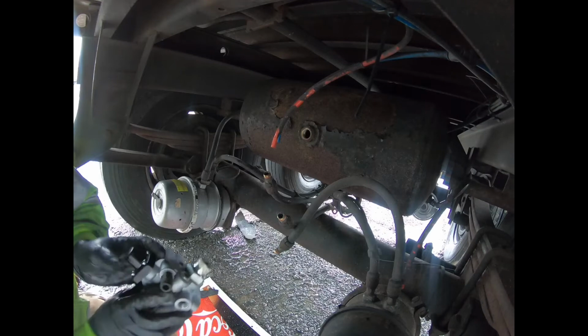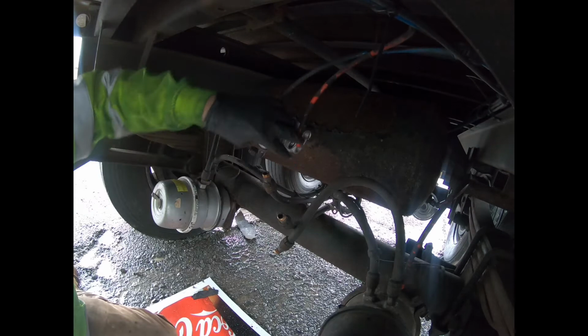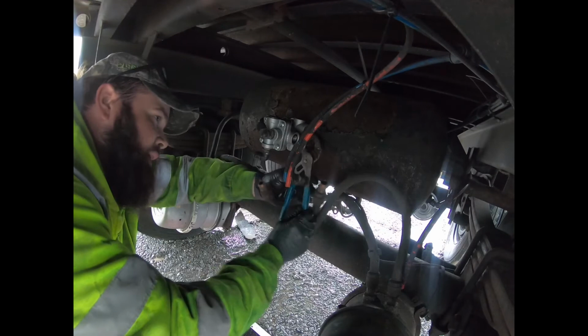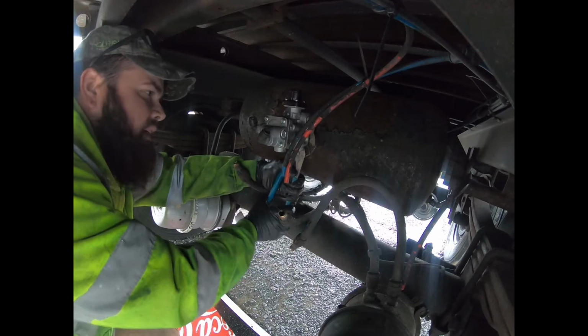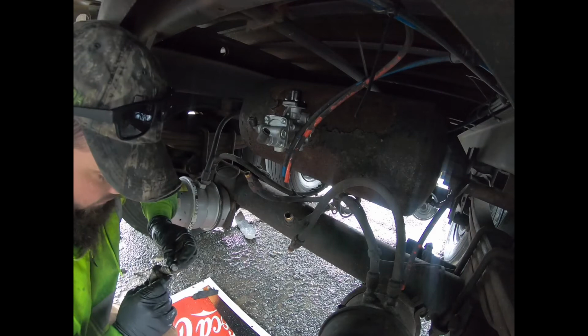I always turn pipe thread the incorrect direction the first time, and you can feel it kind of drop down to let you know you're threading, you're actually lined up. See a lot of cross-threaded pipe, which is no bueno. It is ironic, you know, we don't carry this valve, but funny enough, we keep a tank. I see more tank failures than I do parking brake valve failures.